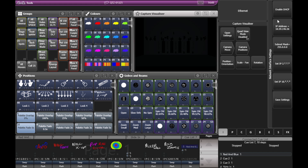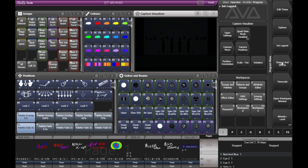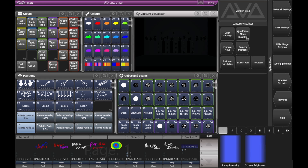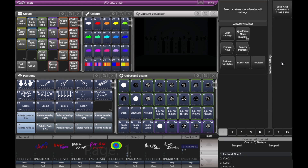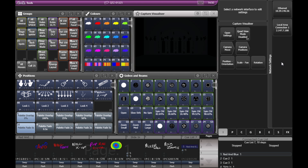We can go ahead and reset its IP just like anything else. We're just going to use it on our 10.0 subnet. If I exit out of the system menu and unplug the cable going into that Ethernet adapter we just plugged in, and then go back into system settings and network settings, we can see that the Ethernet is no longer there. But if I plug it back in and go back into network settings, we can now see both of them again.